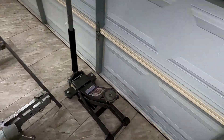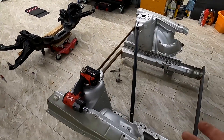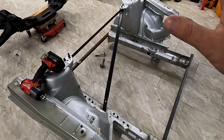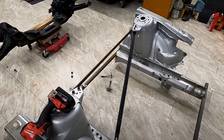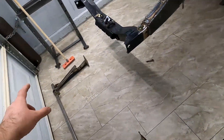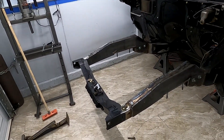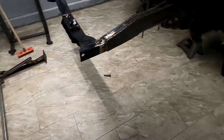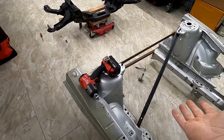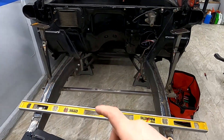I also made the jig that's going to tell me where the struts are going to be located. I accomplished that by cutting this off a junkyard — I went and basically got the whole front end, braced it up, and did a lot of measurements to make sure my strut towers are where they need to be. I built this in one of my previous videos and I also have a video where I chopped this off.